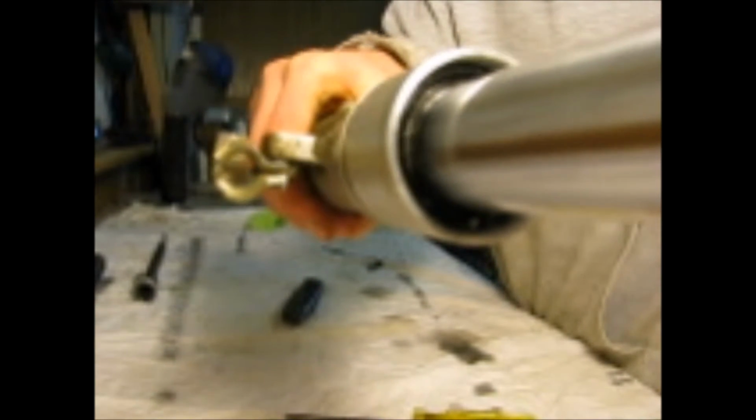Here's our clip. Okay, so we got our cap, our clip, dust seal, spring, this part, and our drainage plug. We have our forks here, and just about ready to pull them right apart and get access to that seal. Okay, so we should just be able to pull them right apart. You can see that the seal is kind of coming out already. So we got our seal out, and here's a washer and the bushing. So now this actually comes right out, and there's the other bushing there. Next you're just going to wipe everything off, clean it all up, and then change the seal.